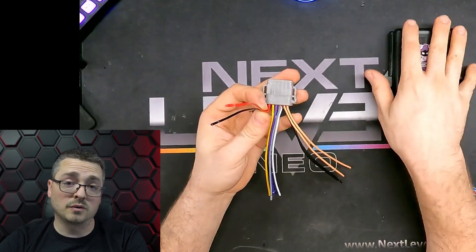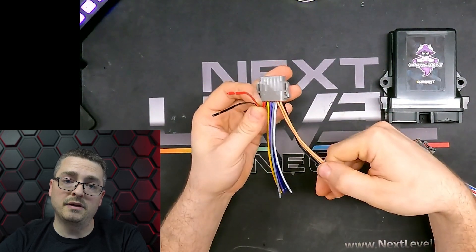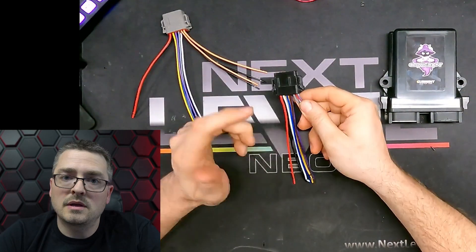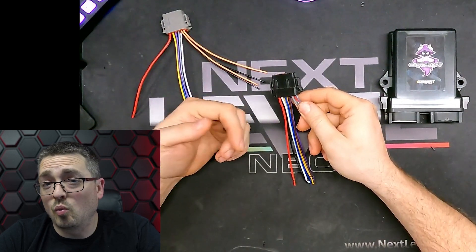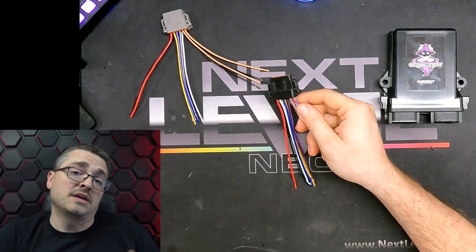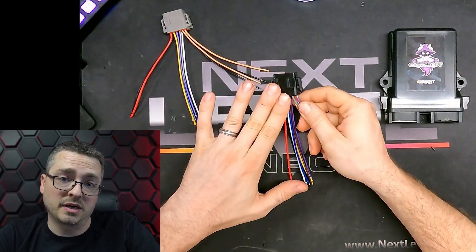The main power and ground will power up the controller itself, and it will also provide power to the 4-amp inverters that are built in. Moving on to the black plug — for this one, the numbers on the back of this plug are 1 through 12, just like the gray plug. And in the manual, it does say 13 through 24. So just keep in mind that pin 13 is actually number 1 on this plug.